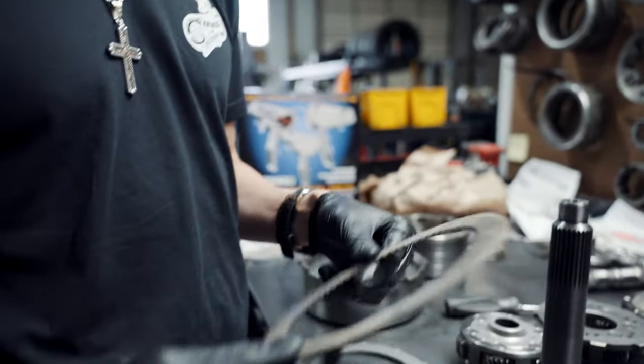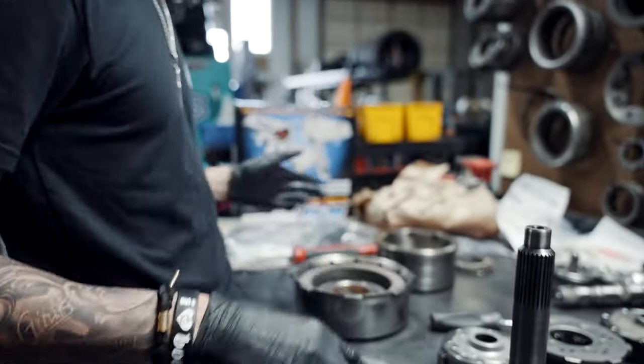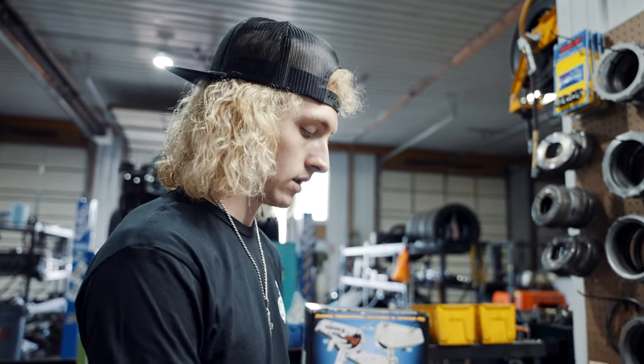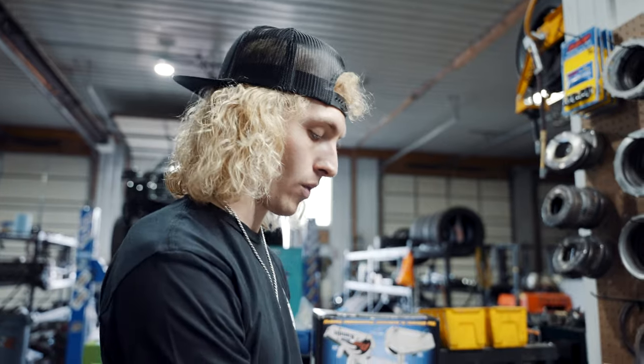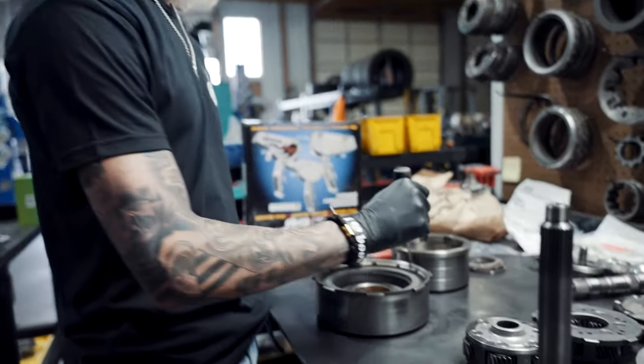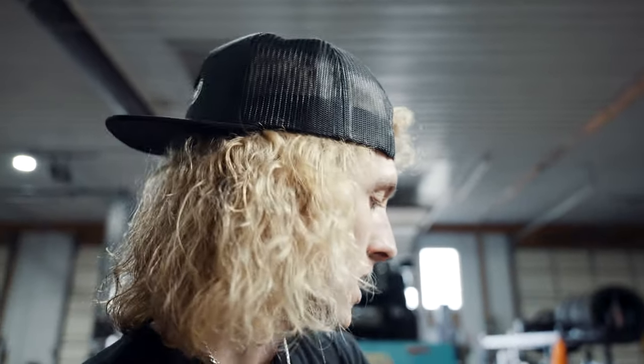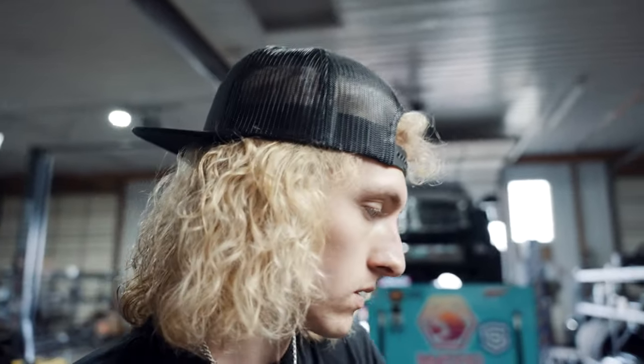A lot of guys like to soak the clutches, a lot of guys like to leave them in dry. In my opinion, some guys like to check their measurements wet with wet clutches. You don't get a proper tolerance reading with fluid viscosity built up in the clutch pads. So I like to do my measurements with the clutches dry, and that's about it.